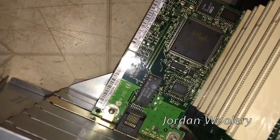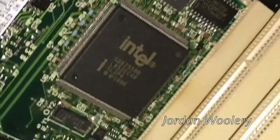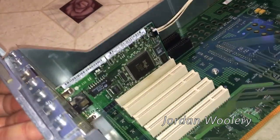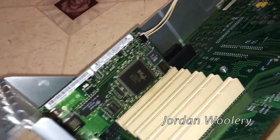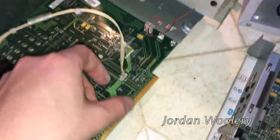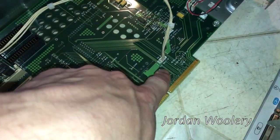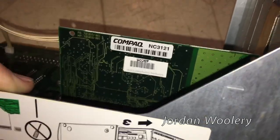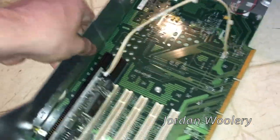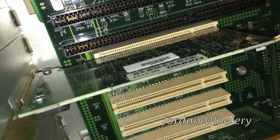Taking a closer look at the LAN card - this is an Intel SB82558B, probably a decent LAN controller at the time with 10BASE-T, maybe 10/100 if I'm lucky. That cable allows for the wake-on-LAN feature, which was definitely new at the time - it says 'Network Interface Controller Wake Up' on the riser board. This is a Compaq-branded part, the Compaq NC3121, but I believe you can get away with installing the Intel SB82558B driver in a newer version of Windows or Linux.